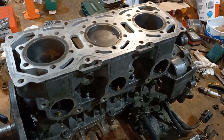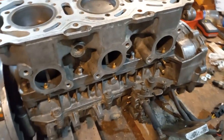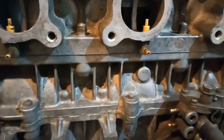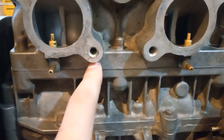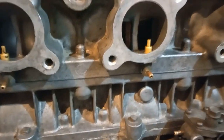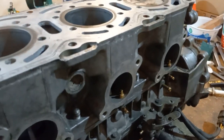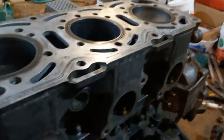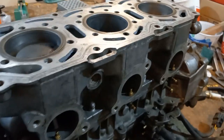Alright, so we got the cylinder bank put back onto the crankcase. It was actually really difficult even for two people, so we didn't film it. What we had to do was run each cylinder at a time, compress the rings, pop it through, and then rotate the crank to move the cylinders one by one. We shimmed the crankcase and the cylinder bank and gradually dropped it down as we got cylinders in. It definitely has a lot better seal than it did now. Even on the intake stroke, you can hear it just sucking the air in — it's sucking air in way better than it did before.